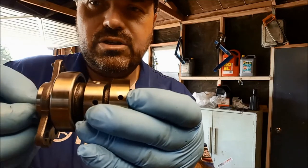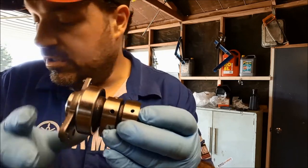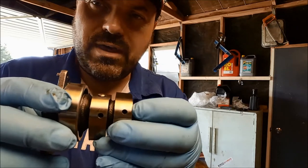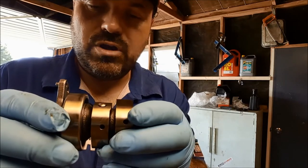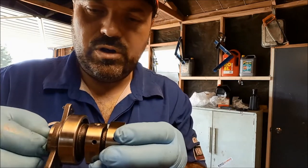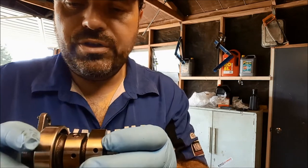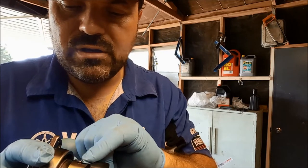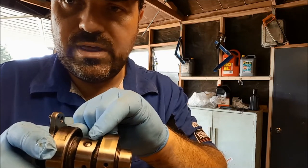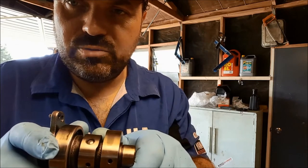The pin only has to protrude a small distance — the manual doesn't give a specific specification. It's going to stop both exhaust valves from fully seating on their seats via the rocker, so we lose some compression for starting. To deactivate, it rotates and sits down below the camshaft lobe area. One thing to be aware of is that the surface area of the camshaft is greatly reduced where that pin sits, so we might see some excessive wear in this region on older vehicles.